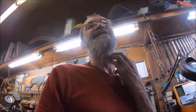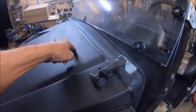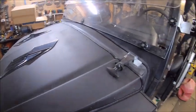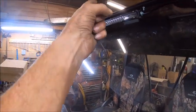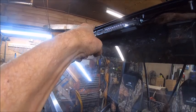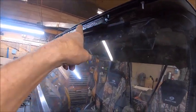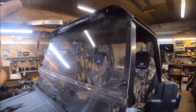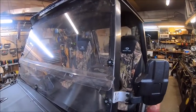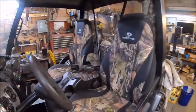So now I have two dashes in my side-by-side. I don't know where I'm gonna put my antenna yet. Right now I've got it down inside of here — I know I'm not gonna get any signal because I don't even have signal in the garage. But I want to try to put it up there on the center, facing upward, on that visor. Problem is I've got to drill through quarter-inch steel and thread it to put a bolt in, because I want it on the outside of the windshield, not the inside. I thought about putting it in the center but I'd have to drill a hole in the cab and it could potentially leak, and I don't want to add any reasons for it to leak.